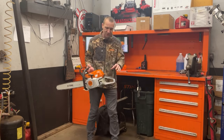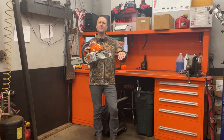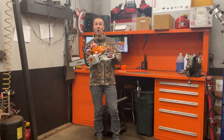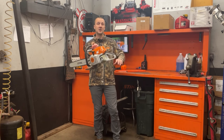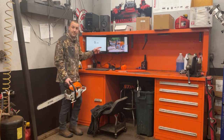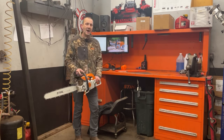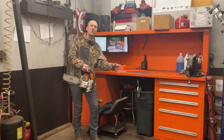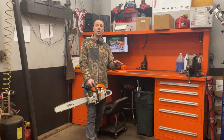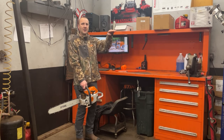What we need to do first is squeeze the trigger and put it in the start or cold start position. This is where you start this machine up — when you fire it up it's kind of running at an enriched idle, just a little sputter, but not like a full choke would be. I'm going to let it run in this position for 30 to 60 seconds — no less than 30, no more than 60. I've got a stopwatch behind me, so once I fire it up I'll turn around and set that timer. As soon as it reaches that time, I hammer down on the throttle trigger and hold it wide open for another roughly 30 seconds. We'll hear this saw go through this kind of tuning process, this calibration, hitting different levels of speed over that period.